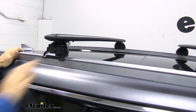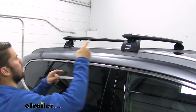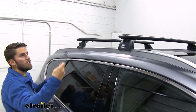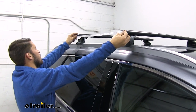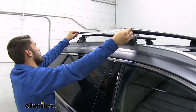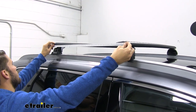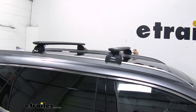Now before we tighten anything down, we're gonna go ahead and measure our crossbar spread. To measure our spread, we're gonna go from the front of our front wing bar to the front of our back wing bar. There's no set measurement. You do wanna make sure you're around 70 centimeters or 27.5 inches, depending on which unit you're measuring with. I would say probably within 3 or 4 inches, or about 10 centimeters on each side, whether you go bigger or smaller. You can base it off of whatever accessory you might be using. I'm gonna go ahead and set it to 70 centimeters,